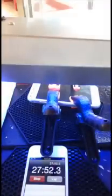If I just take it off, I have a higher probability of getting bubbles. Basically, the clamp squeezes the glue out. So instead of simply removing it, I want to cure what was under the clamp. Let it go another 5 minutes. Actually removing my clamps, and now I'm just going to lay this right on top for another couple of minutes.